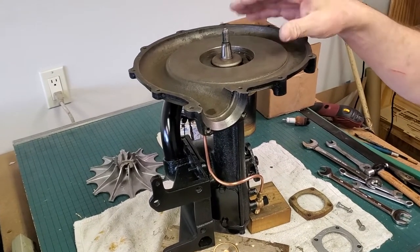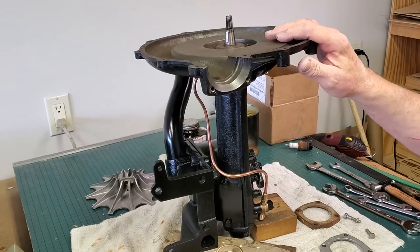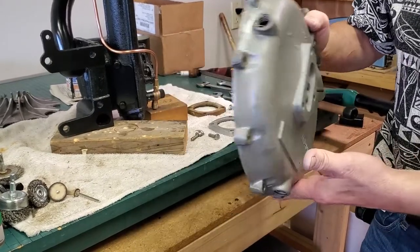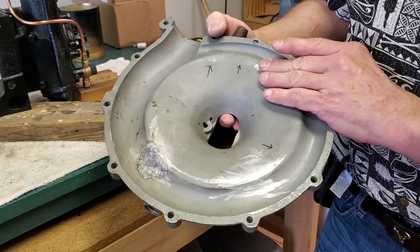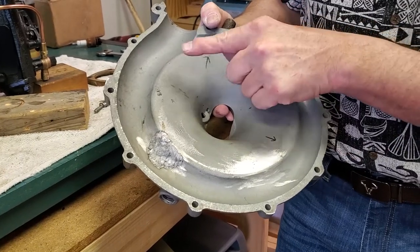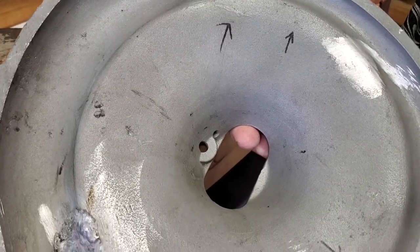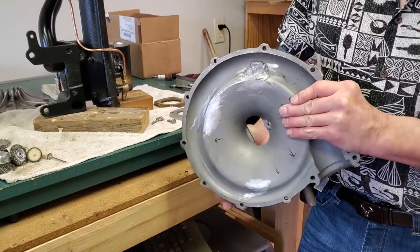The other thing that makes this one super expensive is it's a Hollywood supercharger and he didn't have a good top. I'm holding one that looks really nice on the outside, but when you flip it over there are all these little marks — every one was a leak. What we found is the interior of the supercharger has electrolysis so severe it's basically paper thin. This top turned out to be for all practical purposes unrestorable after trying repairs in three areas.